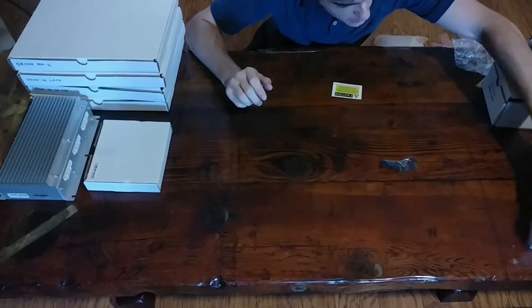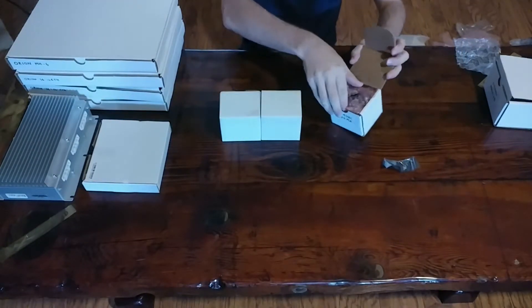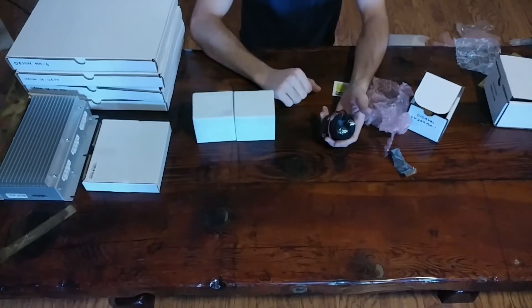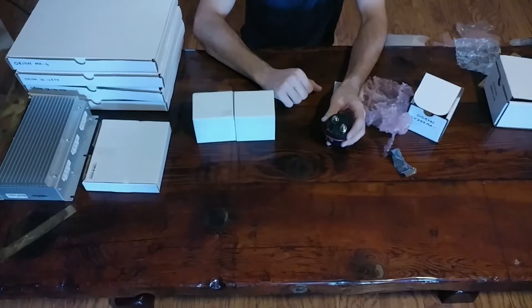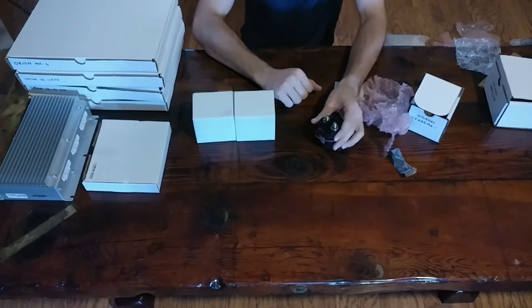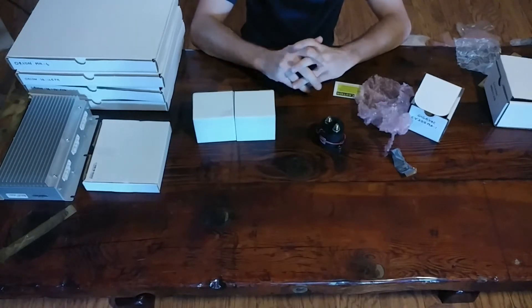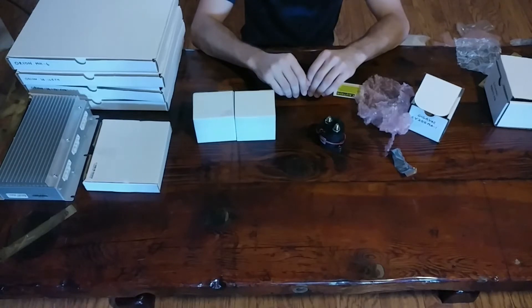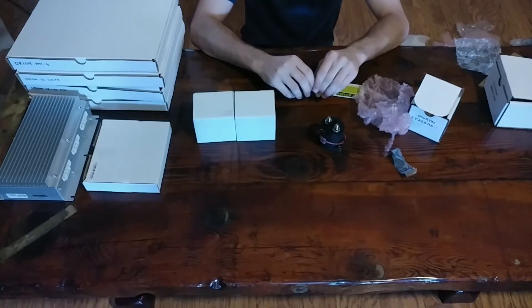To enforce those limits, I have three GV200 Gigavac contactors. These are big relays that take 12-volt outputs from the battery management system, shut-off switches, and safety switches, and will turn the pack voltage on and off. I need one for pack voltage, one for the actual motor — because the motor needs to pre-charge before you can apply full power — so it needs another relay to do that sequencing, and then another for running the high-voltage HVAC components.